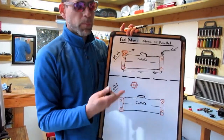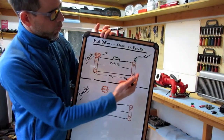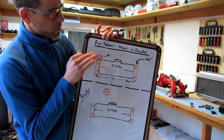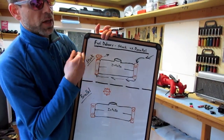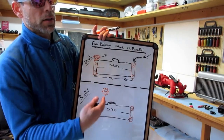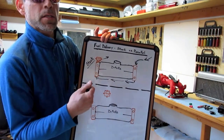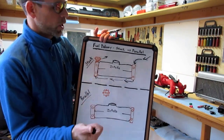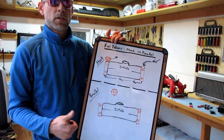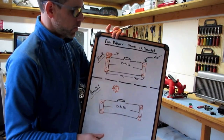The problem with this is that when you're running at high RPM, fuel pressure at the first rail will be higher than at the second. If the fuel pressure at that last injector is lower, it'll push less fuel into your combustion chamber and cause a lean condition. A lean condition leads to pre-ignition, destroying your pistons, knocking on your bearings, breaking your rings and ring lands — anything that leads to a lean fire condition can destroy engines.